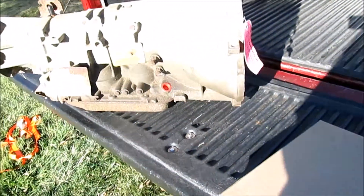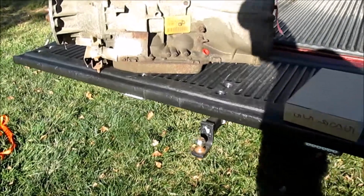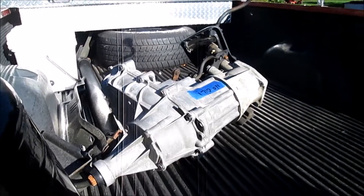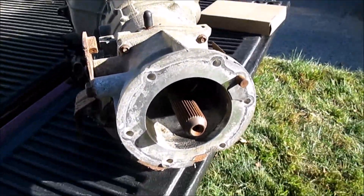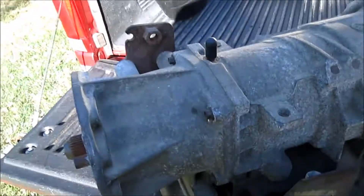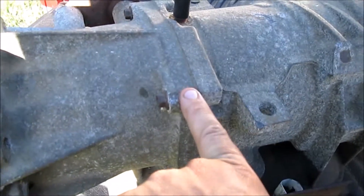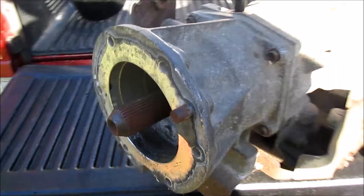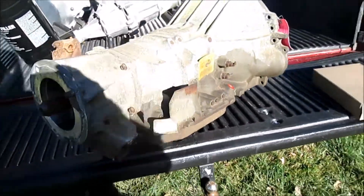I also picked up a Wix trans filter and gasket kit, which I'm actually going to be putting in this evening after I hose down the tranny with some Gunk. We're also going to be mating up our 1356 Borg Warner transfer case to the transmission. We're actually going to be using this extension housing — I really don't want to be messing with these bolts here because they probably may not come out. I'm going to take some Gunk engine degreaser and just hose down the trans, get everything all nice and cleaned up ready for my buddy to install.